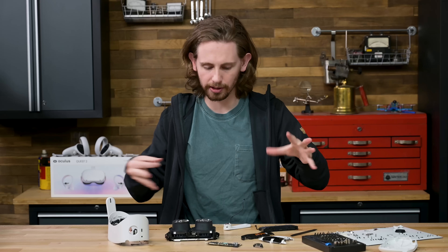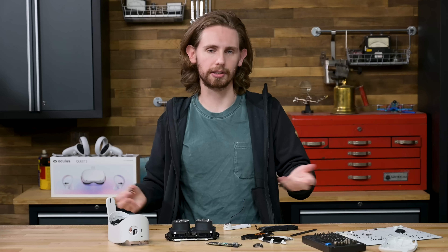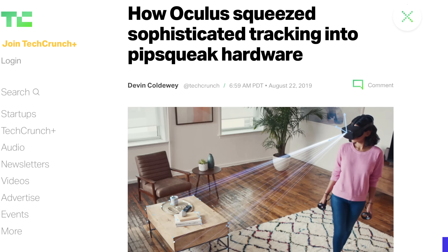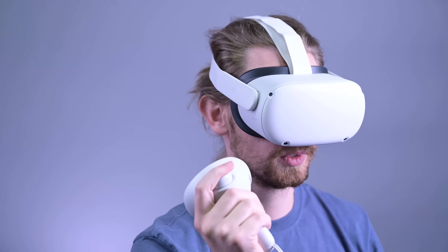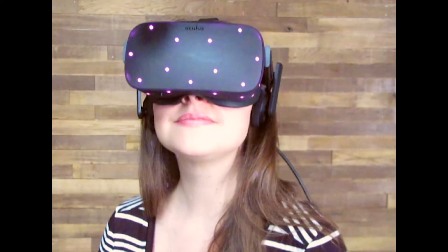Speaking of cameras, now that we're most of the way through this thing, let's talk about how Oculus built this to track movement without any external sensors — that's the most interesting part of this headset for me. Devin Coldaway, a reporter at TechCrunch, got a pretty straight answer from the CTO of Facebook a few years ago, which we'll link in the description. Basically, the answer boils down to three things: they're running the inertial measurement chip on the main board at a very high frequency, leaning heavily on Meta's machine learning computer vision algorithms, and they spent a ton of time carefully tweaking the output of the entire system to closely match their old systems that did use external sensors.